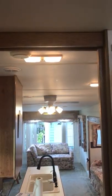Okay, we've got dual lights in here, so if you're one of those who like to read, you can go down to one light or just daylight for a more subdued experience. We've got a twin switch panel here. This is a 12 volt panel, and it's going to control your hall light as well as your bath and water closet light. For comparison, on the left you're going to see an 1156 RV style incandescent bulb, and on the right is the same 1156 LED chip bulb. One obviously sheds more light, is cooler to the touch, and uses less power. So we like the LED bulbs. They're refining them more and more, and I think someday you're not going to see the hot incandescents on an RV. Again, it's night and day difference here.